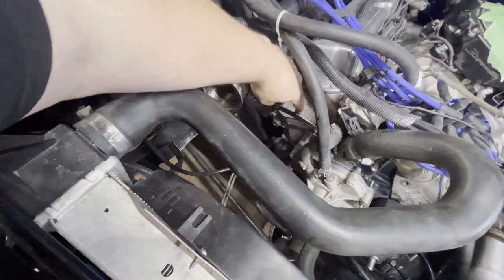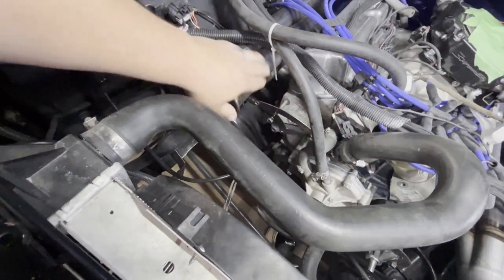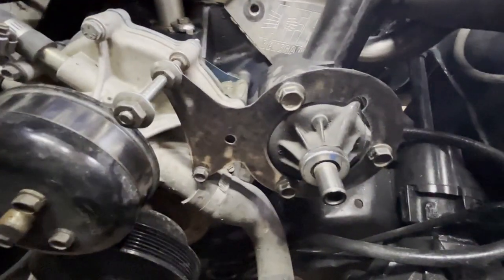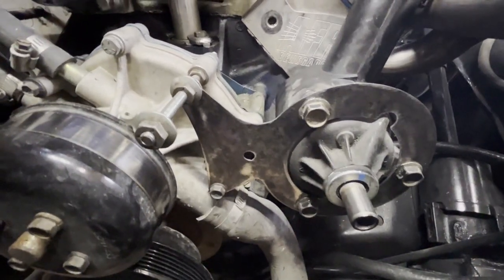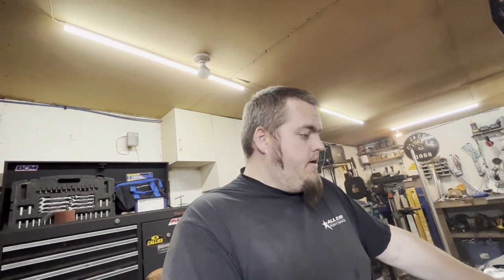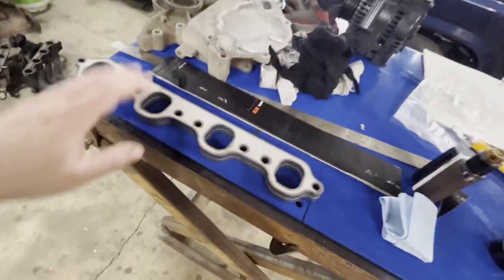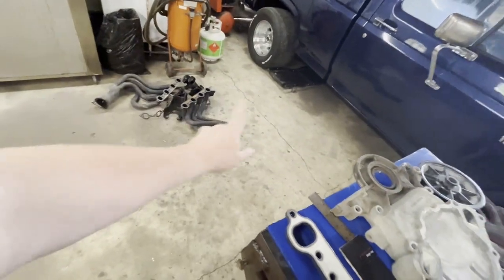Day two. I was relocating the power steering pump and alternator, and I think I have a plan. I really lucked out — I cut some templates out of 16 gauge; this is the same bracket I built for another Ford and it seems to work. It'll just need a different style of alternator, but that's a small price to pay to get the turbo in here. I also made this bracket for the alternator and power steering pump. I just made it out of thin 16 gauge as a template so I could make sure the plan would fit and work before cutting thicker material.